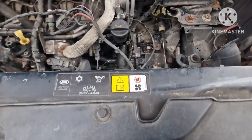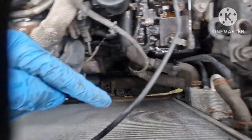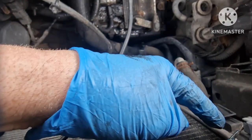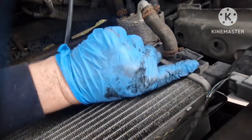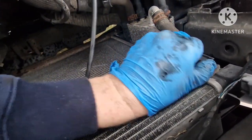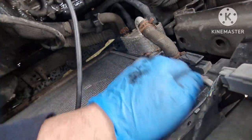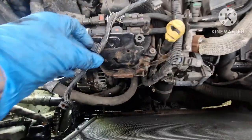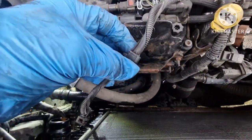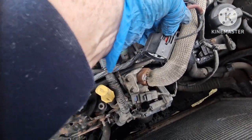And what I did, which was really awkward, I could be wrong, but I took out the cooling fans on the front here, and you've got 2 clips. No, sorry, you pull the tab out a little bit, you can see it just there. So you just put a little screwdriver behind it, or just pull it out with your fingers, make sure it's not too cold, or it will snap. It could be very brittle, but a little screwdriver behind, just ease it out a little bit, and that'll pull straight up. You've got the same on the other side as well, and you've got loads of these little metal clips, like speed clips. They're clipped onto the housing, so just prise them off with a screwdriver carefully. You've got the fan connection, which you just squeeze and it'll pull off quite easily.